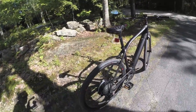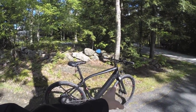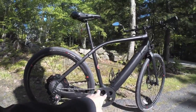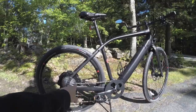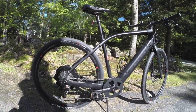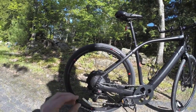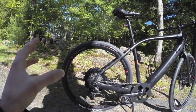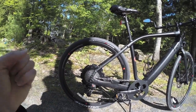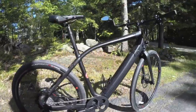Again, that's true of all gearless hub motor designs. And the other advantage is the battery weight's up front and the motor weight's a little bit in the rear. There are new electric bikes that have the mid-drive, but they put more stress and strain on the gears and the chain, and it's assisting you more as a rider, whereas this one's a little bit separate, but it's applying that force directly into the wheel. And given the nice thru-axle design, it's burly, and I appreciate it. I think it feels really smooth, and again, very quiet.